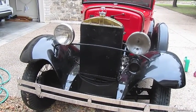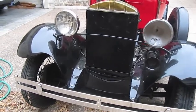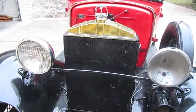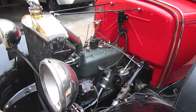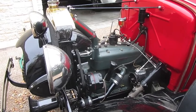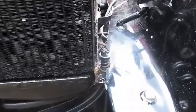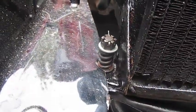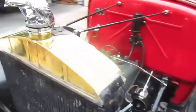This is the stage of putting the radiator back into the Model A. Right now I just have it barely in there to run the engine — there's no hood yet. You don't put the hood back on until you fill it up with water and make sure everything is running with no leaks, because taking the hood on and off the Model A is very challenging by yourself. You'll assemble the radiator back in on each side — you'll see one mounting bolt on the bottom left and one on the right. Start with those two, then put the hoses on next.